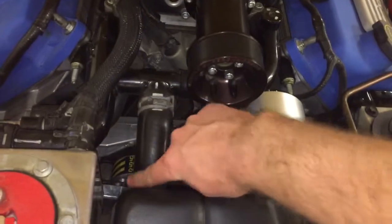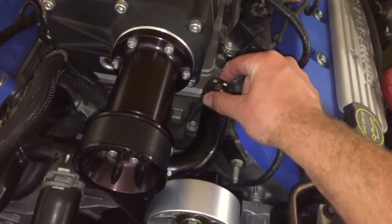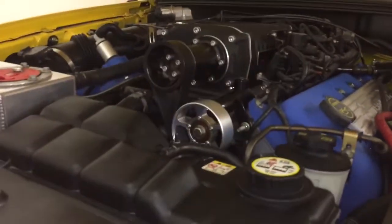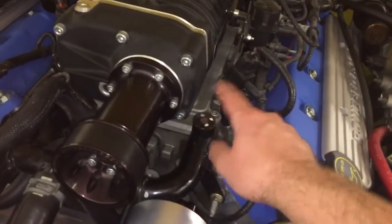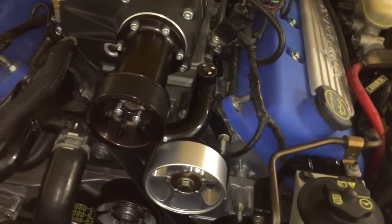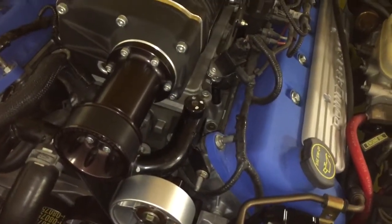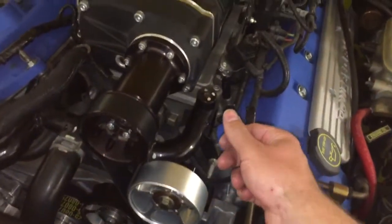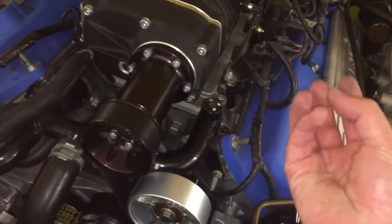Out front here is the crossover tube for the coolant. You can see it goes into a big radiator piece. You can take this cap off — and because it sits at a higher point on the engine, you can burp the cooling system by letting air escape at the highest point. These caps strip very often, so if you still have yours, it's a good idea to get a little quarter-inch drive, go in there, break it loose, unscrew it, and put a new one on.